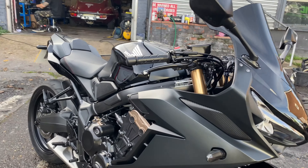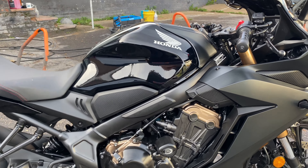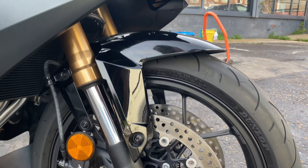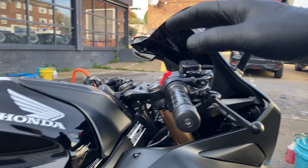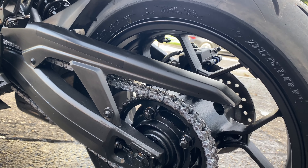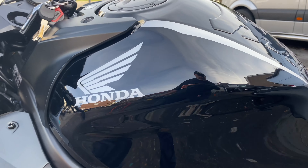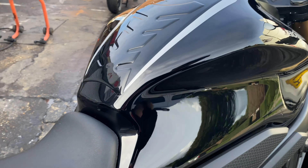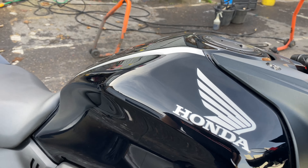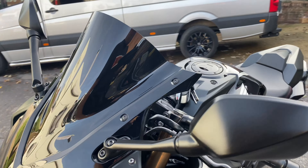Two and a half hours on the dot — this Honda CBR has been fully trotted and looking freaking sweet. This has had one of our legendary full monte valets with the additional half-price ceramic. Look at the gloss on that! Everything has been cleaned, polished, and protected. XCP corrosion protection on all the motor, behind the headlight, all your switchgear, suspension linkages — all had a nice coating. Chain's been degreased, all that old rusty chain lube thoroughly cleaned off, blow dried, and re-lubed. All the wheels have had the Ultimax ceramic. I did a two-stage machine polish on all the bodywork — it was quite heavily marked up. Look at the gloss now — mark free, like a mirror! Then we prepped it and treated it to the Ultimax signature pro — that's a five-year ceramic protection on all this bodywork.